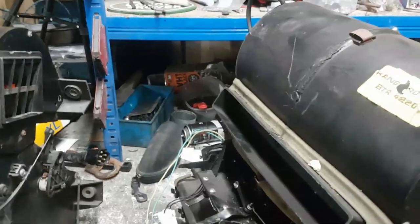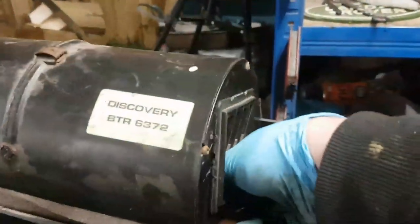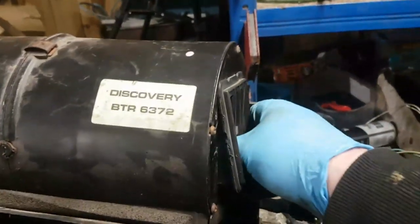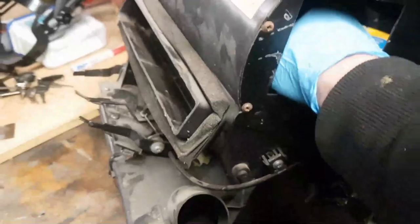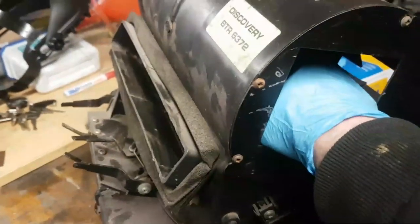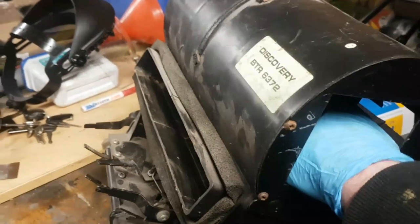See what the motor's doing inside this. And if the motor is lunched in this, what I've noticed is in this one, if I take this end plate piece out, it's going to come out because I just put the thing in there. Sometimes. Right, what I have found is the motor in here has got a fair bit, like a centimetre and a half of back and forth movement, which I'm not happy with.